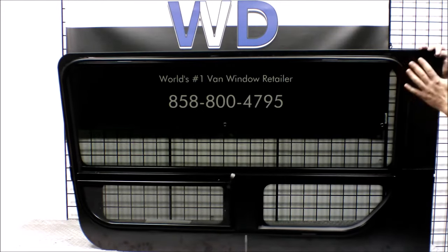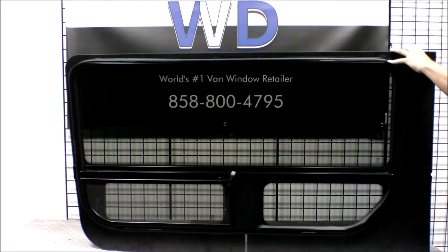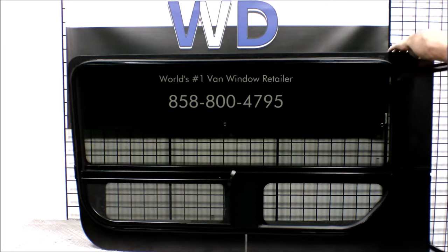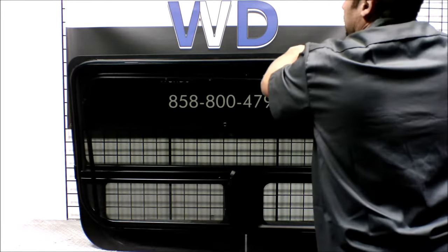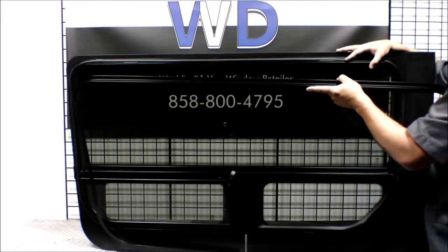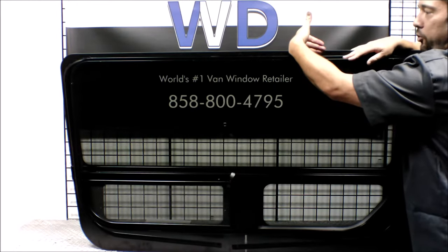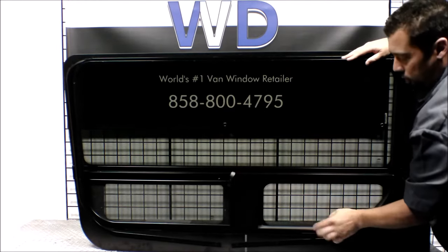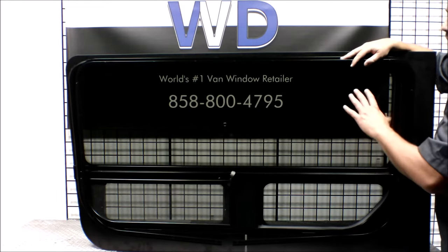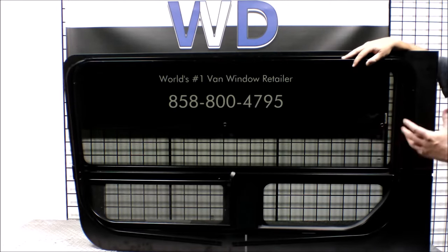The way this attaches is you have a channel right here that screws are going to go into. First, you put on a clamp ring — here's the aluminum clamp ring. If you can imagine the window coming in from the outside of the van, the clamp ring is going to be on the inside. It attaches to itself and the wall of the van wedges in between the two. You have holes all the way around, and you put your screws through a little bit at a time — kind of like a tire — top, bottom, left, and right, tightening them up a little bit as you go so that you get a nice even seal.